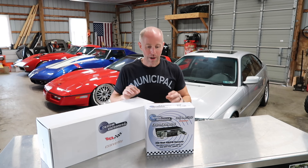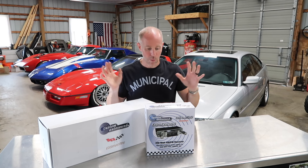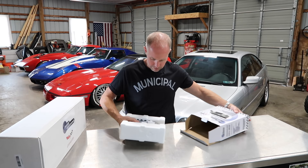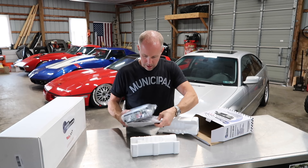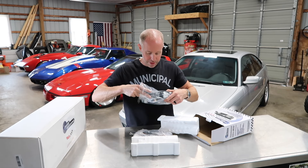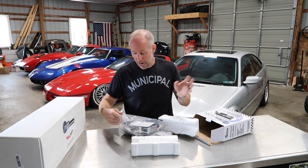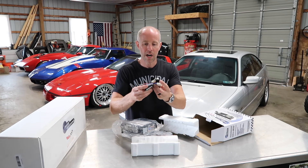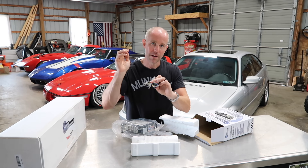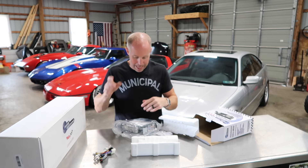So this is going to be perfect for that. I'm going to leave a link in the description for these — I believe I got these both from Summit Racing but you can get them from pretty much any vendor. So this is the head unit. As far as wiring is concerned you're probably going to have to splice this in. I'm not sure if there's a harness that goes from the factory to this harness — I didn't do any research on that yet. There was just the harness that comes with it that plugs in the back of the stereo, and then the wires are all labeled for your constant power, your key on, your ground, and your antenna wire. The basic stuff — if you've ever put a head unit in a car before, that pretty much covers it.